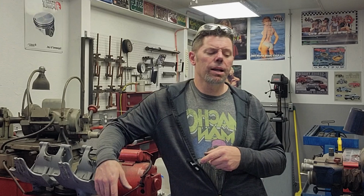And something else too, a lot of these older tractors that have been around have overbore kits that they're putting in. Now with a Super C, I'm still running the stock Super C bore, which is 3 1/8 inch. I could have done the overbore kit in this tractor. You can get a 3 inch 250 overbore kit, but the cylinders and the bores were really good shape in this tractor. I couldn't justify spending the money to do that. So I think maybe at one time in this tractor's life, someone might have done a rebuild kit on it.